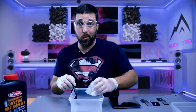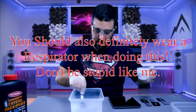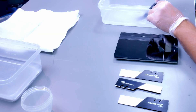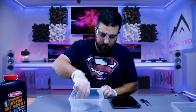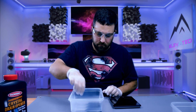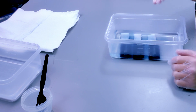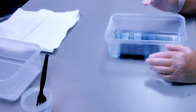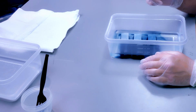Now I want to dissolve this into the water — again using plastic to stir. You'll also notice I'm wearing gloves and goggles because this stuff is super caustic. Let's soak these heat spreaders. You should almost immediately see it starting to bubble and the water turning black — that anodizing is already starting to strip. At this concentration it should only take a couple of minutes to strip the anodized layer. You don't want to keep it in there much longer than that because it'll start to pit the aluminum itself.